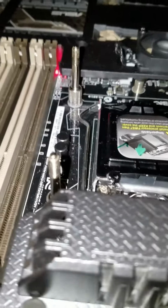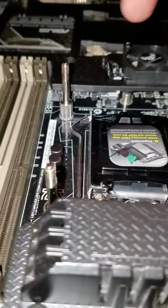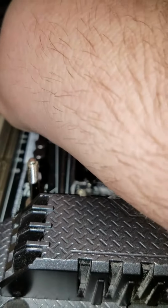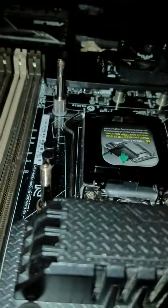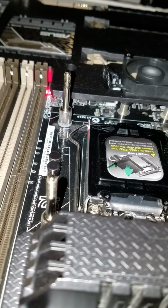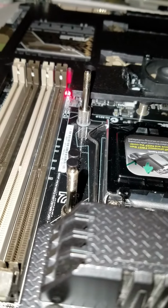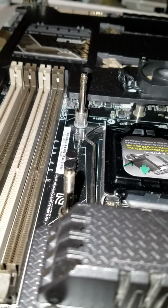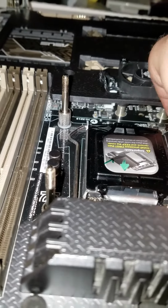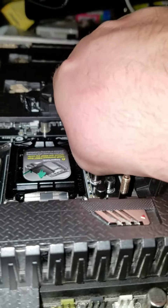on this side, it will post properly. However, now this isn't tightened down all the way yet. If I tighten it down just hand tight, about every other time, it will attempt to post. Now, whenever I mounted the water block to it earlier and had it in the system, it wouldn't post at all. I just tightened down this one here,